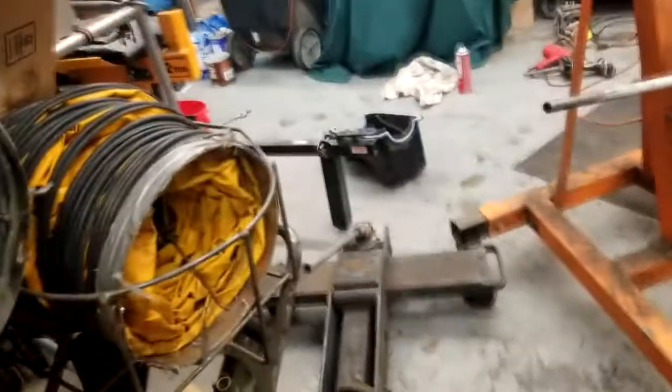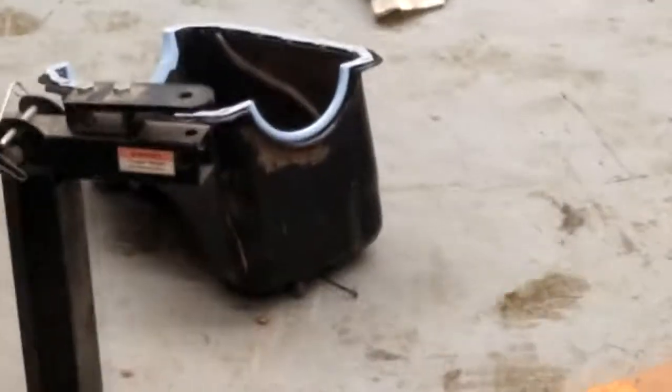All right, after 10,000 years, I think this project is close to getting done. Inspection plate off, motor mounts off. It's a pretty clear shot for the oil pan to go up in, so I'm going to finish doing one last final clean on the mating surface for the block, and that little thing is ready to go in. Well, the oil pan's all back on and torqued.